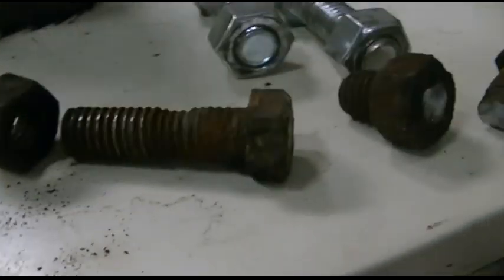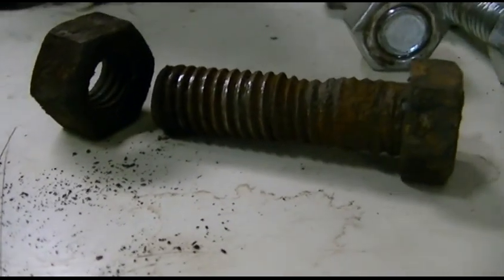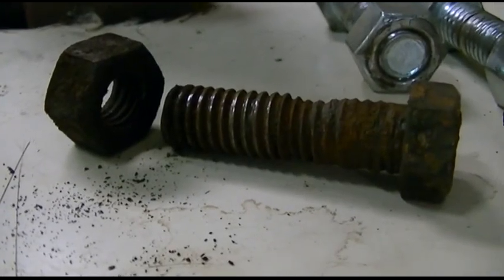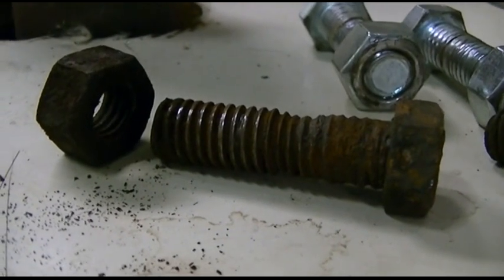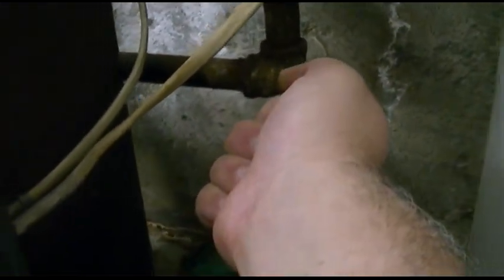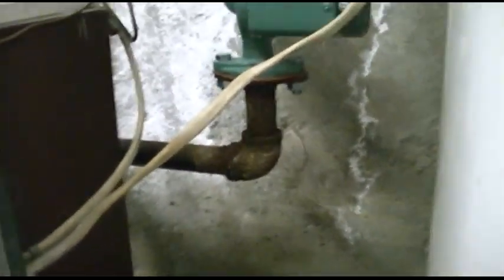Here's the one I could get out. You'll notice there's a very thin section of threads there. Unscrewing this, you can see the silvery metal — and it made a sound kind of like when you take lug nuts off a car, that squeak or creak sound, the entire way coming off. You don't have much room here because you can't work it with a regular ratchet. You have to put a pipe on it because it's too tight, so you only have a swing of like a click or so. It's pretty tight to work on.